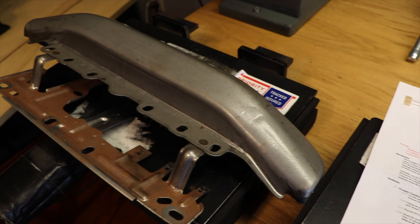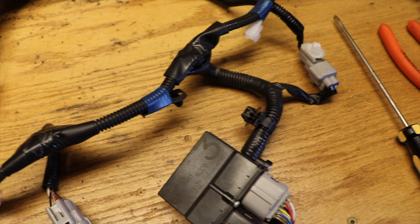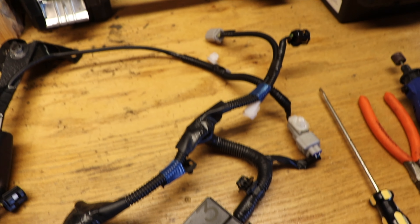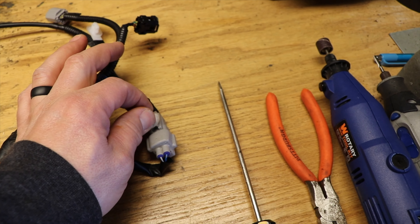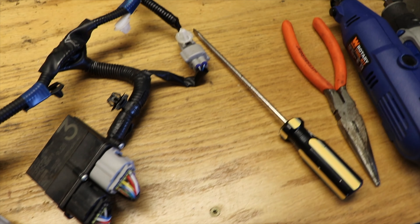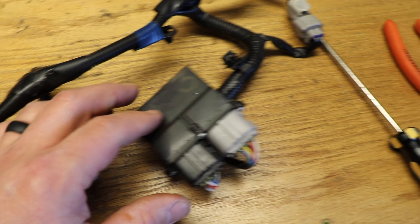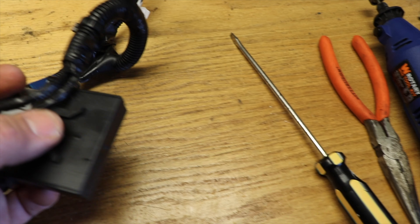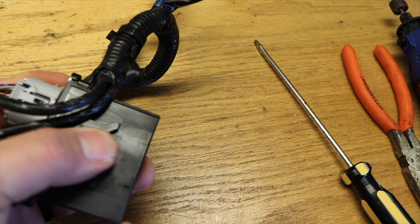What I've done here is remove all of the wiring from the electronic bracket, so now we have everything laying out separately. This makes it much easier to work on. The way you do it is just squeeze these little white tabs and use a small flat head screwdriver to push off these little catches, including the catch on this module, to slide it off the bracketry.